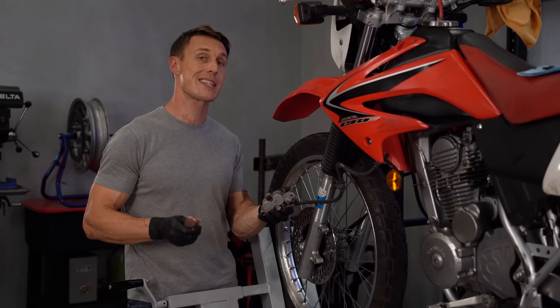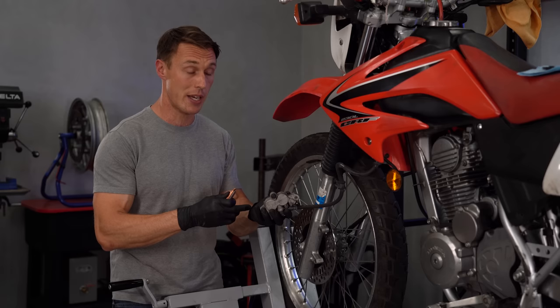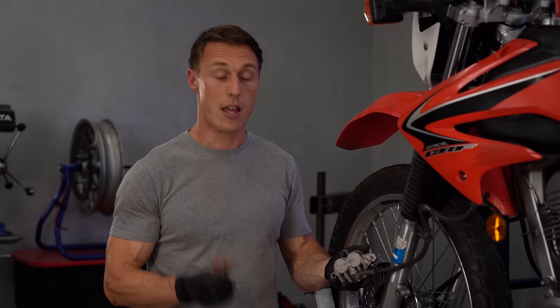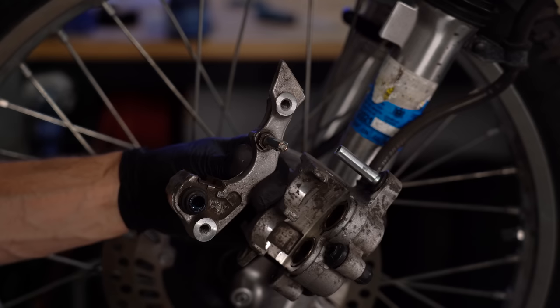It is finally time to install the new brake pads, and perhaps you've heard that you're supposed to apply some grease to things as they go back together. Smearing high temperature grease on the back of the pads and on the pad hanger pin is supposed to help things move freely and reduce squealing, but in my experience all it does is attract dirt and make a really big mess, so I prefer to assemble everything dry. The only place I would recommend applying grease — specifically a silicone-based high-temperature grease — is to the inside of the boot and collars, if you have a slide pin caliper mount as we do on this CRF-230L.